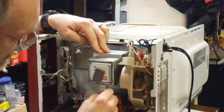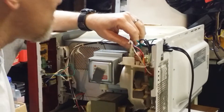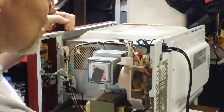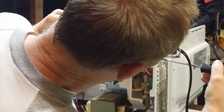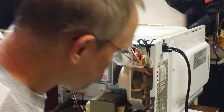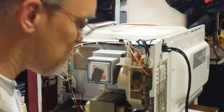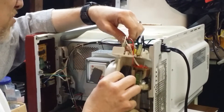Now we can unplug the magnetron itself. We have access to the screws on this side but the fan is in the way, so we need to take the fan off. Often the fan is part of a group of things on a plastic holder that will all come out together. Take off a couple of screws on the back. There is often one screw to the case where the diode attaches to the frame, which is part of the high voltage system that needs to be taken off as well. Then usually the fan, capacitor, and everything all comes out as a unit.